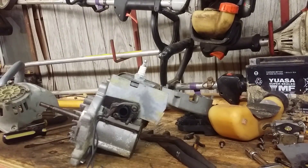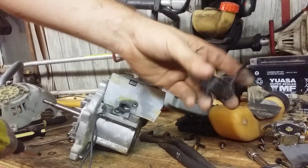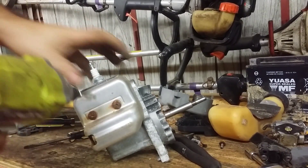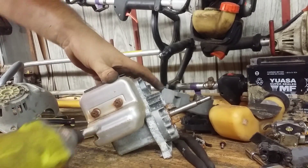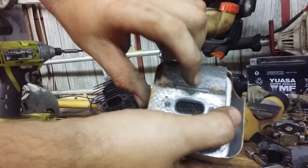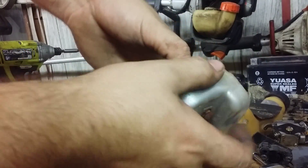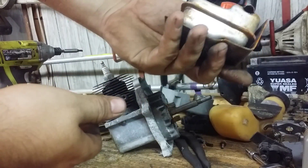Another Ryobi — should have started with this drill. There's another isolation gasket, another paper gasket, wires you don't need. Here's your exhaust pipe and muffler. The way a muffler works: if you look straight inside, this one specifically has a bunch of mesh that catches the soot and ash. This shiny piece is a graphite gasket. The air goes in and just bounces off different pieces of metal, and that takes the sound out of it.